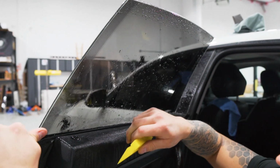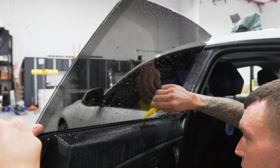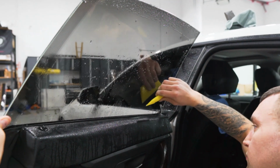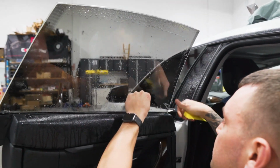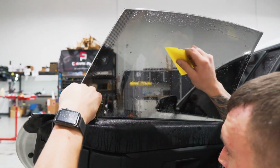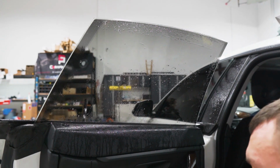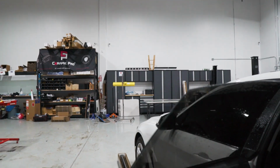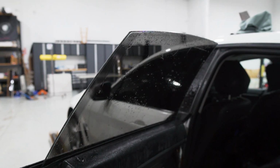Now when we do the bottom edge, you can push on the glass and open up that bottom section, or we could do like we did on the front door and use an easy reach tool. Open up that seal and squeegee down. And we can push out the top with the blue Huck towel and the heat gun with the gray lid coat card, and then we'll go on the outside and heat up the bottom edge and push out any fingers that are popped up.